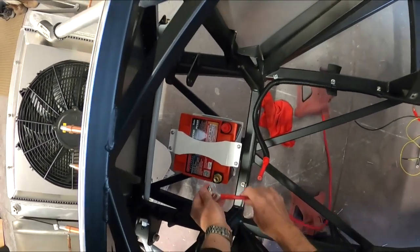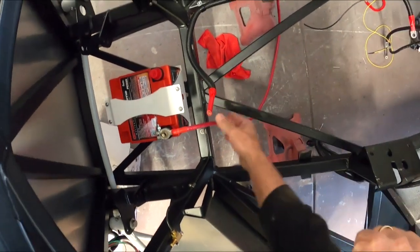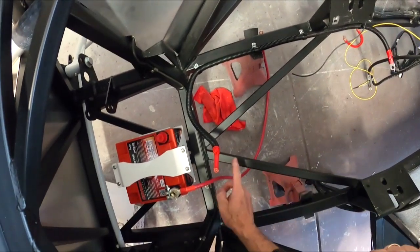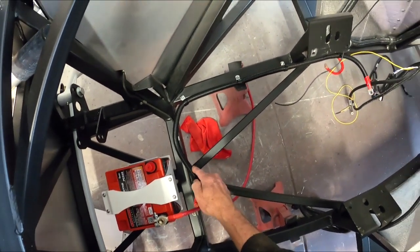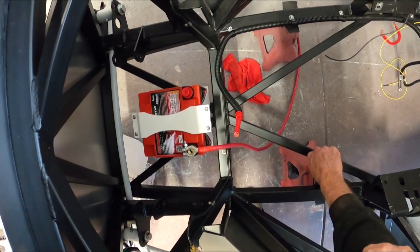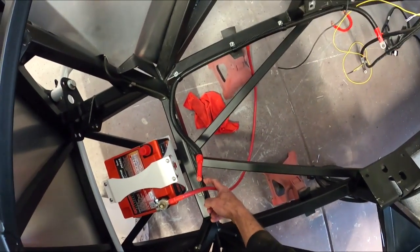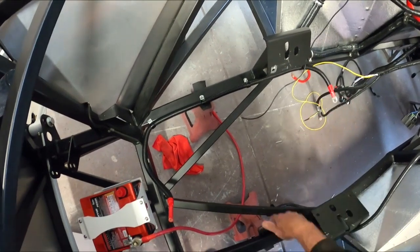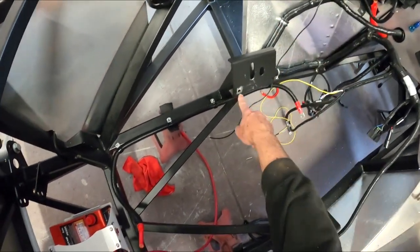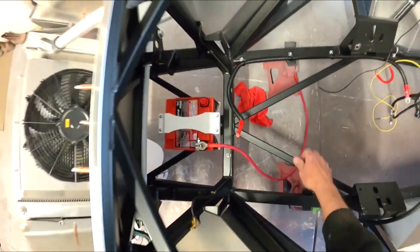I've got my battery cable here — it's going to go in like this and come straight down. That should look pretty clean. The rest of the cable will kind of wrap around. I'll put this in black — actually I like to keep everything red; this will get wrapped in red too so you know it's a positive cable. Just one of the electrical things I like to do — not always necessary but it's safe. I'm going to mark this, snip this off, and make sure I clean the paint off there, then tie in the ground here. The starter will tie in there, the engine ground into there, the Coyote ground into there — this thing should be pretty good.